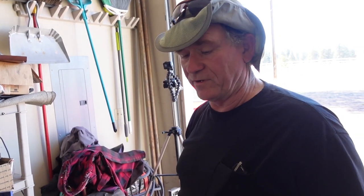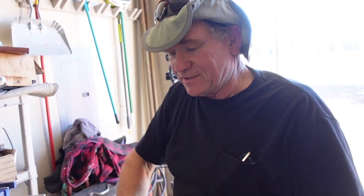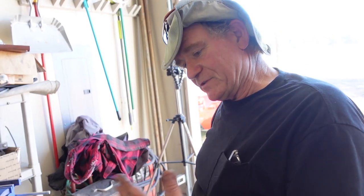because it's this nice little splatter weld, but it gets in there and penetrates. This stuff will penetrate as long as you're down into the root. And then you gotta clean it up and put some pass over the top.